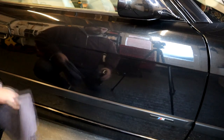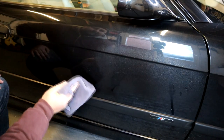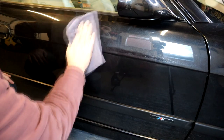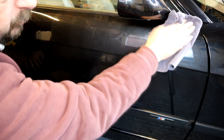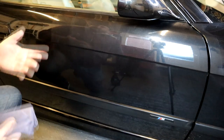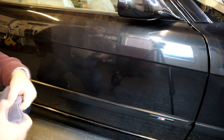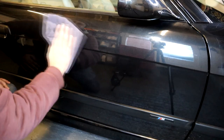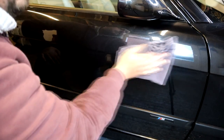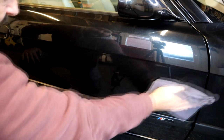So I'm applying this product live. I'm going to tackle a square like that with one squirt. This cloth has got wet with product — I've been using it as the applicator cloth. So all I'm doing is forming a film with the liquid, and that film will have a little haze to it. First of all, form the film all the way up to the edge of the panel — that's with any product. Then take the second cloth, give it a second for the water to come out, and it will bond to the panel, do its thing, and then give it a buff.